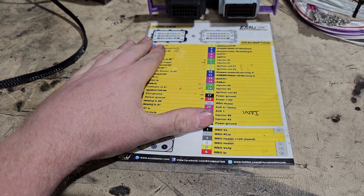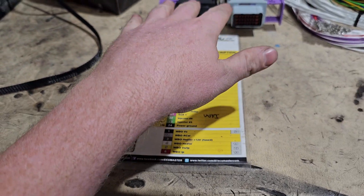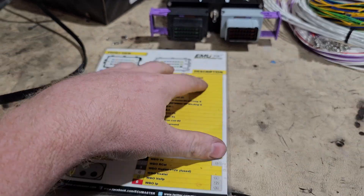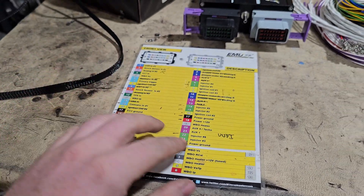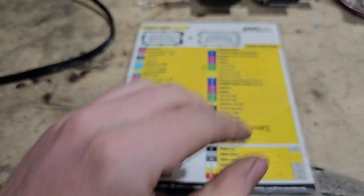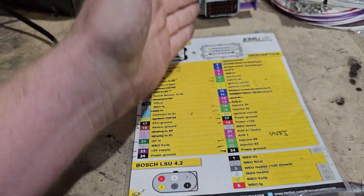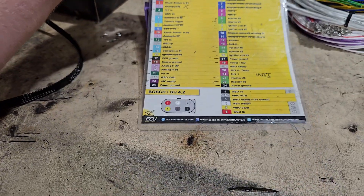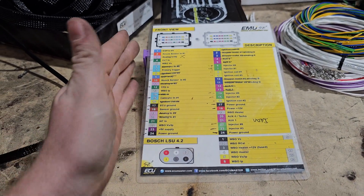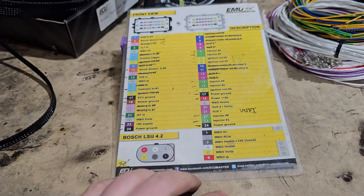That is pretty much the basis of how you would wire up your harness based on the pinout of your ECU — it's fairly simple. When trying to learn pinouts or pin a factory harness, some sensor names on factory harness pinouts may have code names and you'll have to do some research. Sometimes they're directly named and you can understand it immediately. Remember, this is not as hard as you think — do not overthink it. If you're using a different ECU, this will still help you; the names may differ but research will help you.